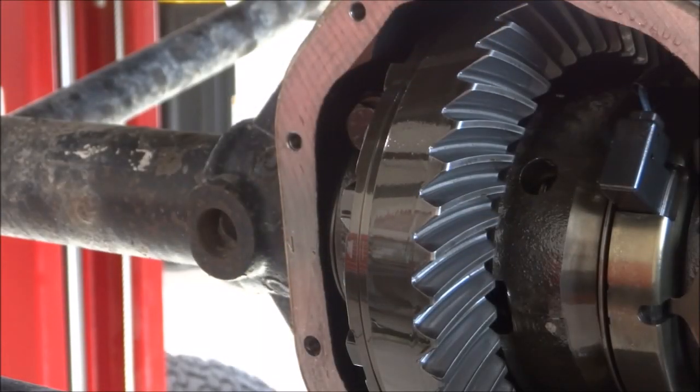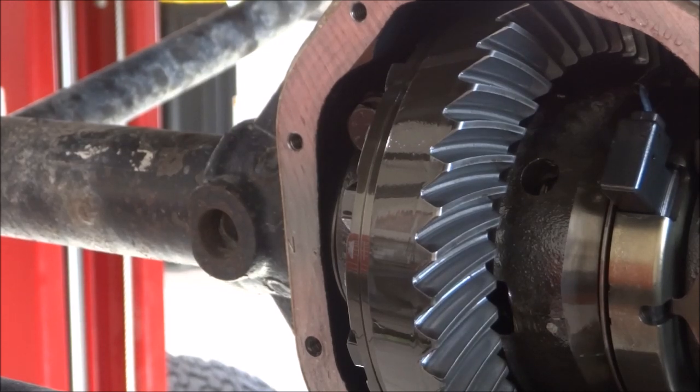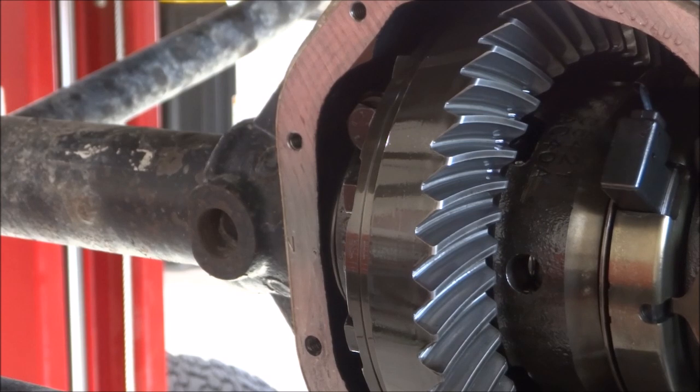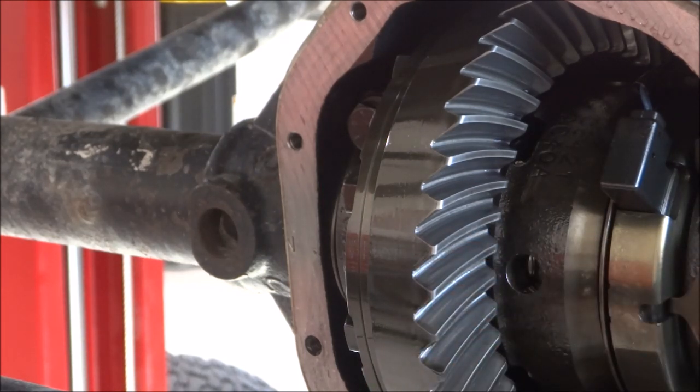I got the cover off, and I just wanted to do a shot of the gears there. See if I can turn this and get a look, see how good those gears look after. I've got 77,000 on the odometer, and I think it was around 5,000 when I put the axles and gears together on this. So 72,000, I think I've towed it about another 22 to 23,000. So we're coming up on 100,000 miles, and gears great. Nice wear pattern, everything looked good.